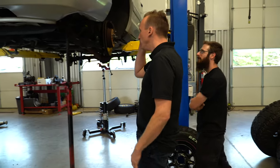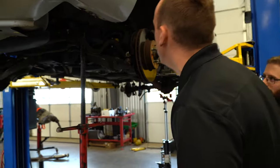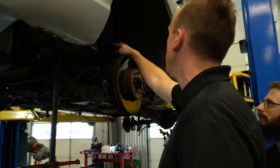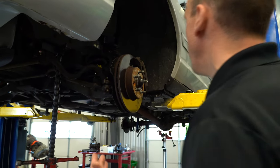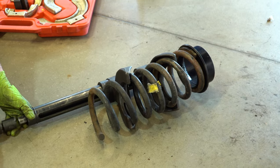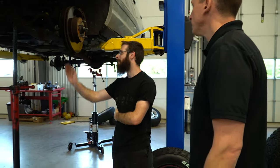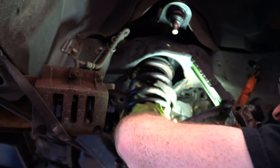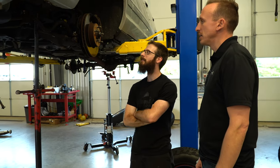Looks like we've got maybe a sway bar drop. Yes. Made out of some simple box tube. Right. We've got this fancy drop ball joint. Mm-hmm. And you can't see it, but I guess there's a coil spring spacer up inside there. The spacer's actually about 4 or so inches tall, but with the way that it's kind of more inboard on the control arm, 4 inches here means 6 inches out here. Yeah, right, that makes sense.